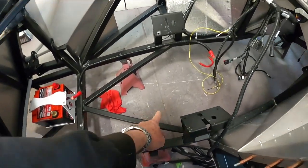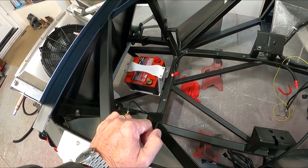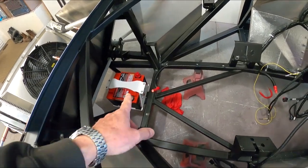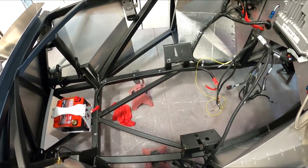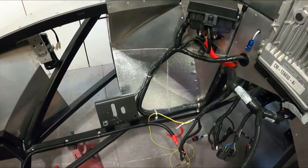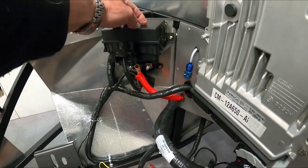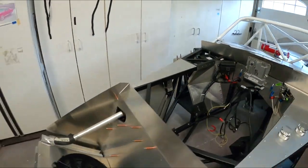I'm going to run a cable from the alternator directly to the positive post on the battery — should be about a two-and-a-half foot run of probably number four wire, which should be plenty for a 150-amp alternator, which is what the Boss 302 alternator is. Then from there I'll run a wire from the battery to the starter — that'll be number two AWG wire. From there I'll tap off to a mega fuse up under here, probably four AWG, and then from the other side of the fuse it'll go into the Coyote control power distribution unit and then inside to our switch.